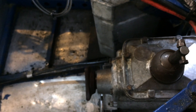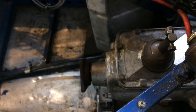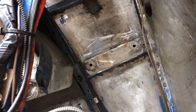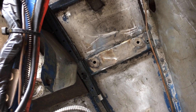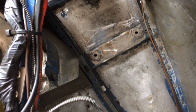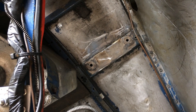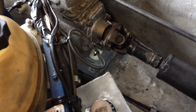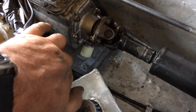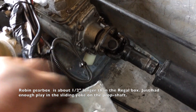I'll go and mark the positions of these holes, drill two holes, mark the cross member and then weld in a couple of captive nuts. I've welded in two nuts into the cross rail there. I'll take my new bracket - I've just got to re-secure my petrol pipe down there, then I can get the gearbox back in. I've replaced the rubber bushes at the back of the gearbox mount with some nylon bushes that I made up.